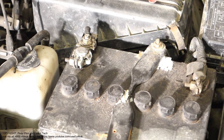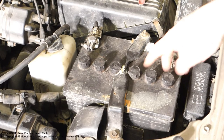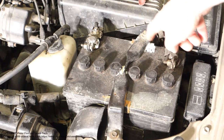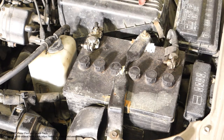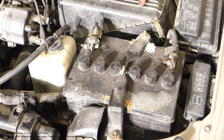It is like insulation material, and it stops this electricity movement. So we need to do this service and repair and remove these corrosions. The service and repair happens so that first I need to take all of these cables and this support bar away, and then I need some metallic brush to remove this white corrosion, and then I need to lubricate these things with oil or some vaseline-like oily paste. One of the best we can use here is this copper paste. It is an oil-based material that is very resistant against corrosion.